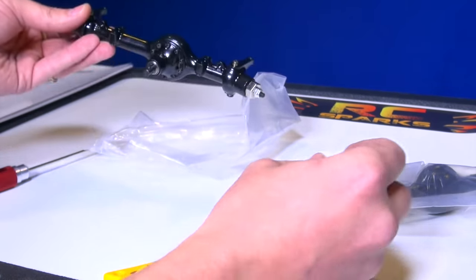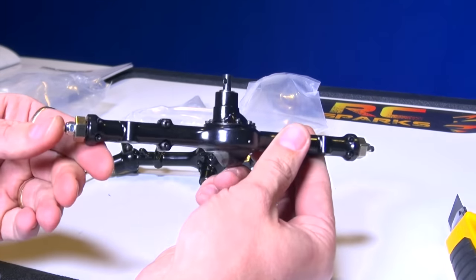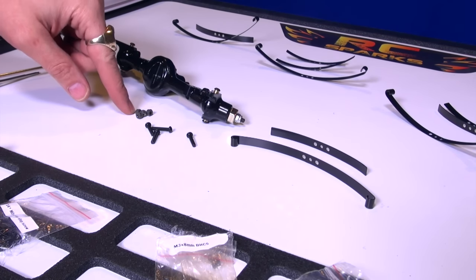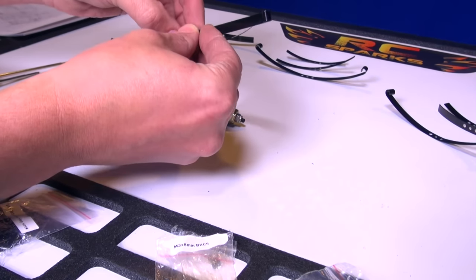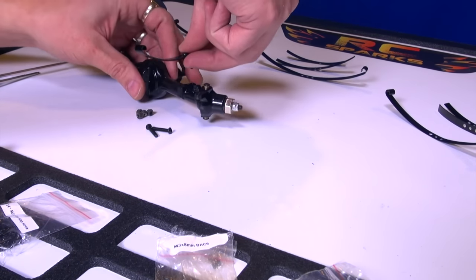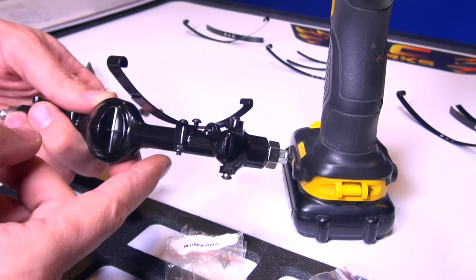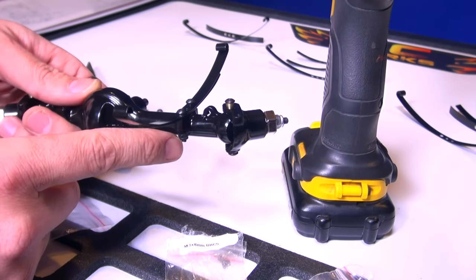It's already done. The rear axle is different — you can see it's just a straight axle that doesn't have any steering components at all, so it's very easy to identify. I'm going to need four 16mm M3s including the lock nuts. The two springs — smaller one on the bottom. I'm going to just slide these longer screws through. I've got the leaf springs and both the leafs I want are in place. I've taken an M3 16mm screw and put it through to an M3 lock nut.